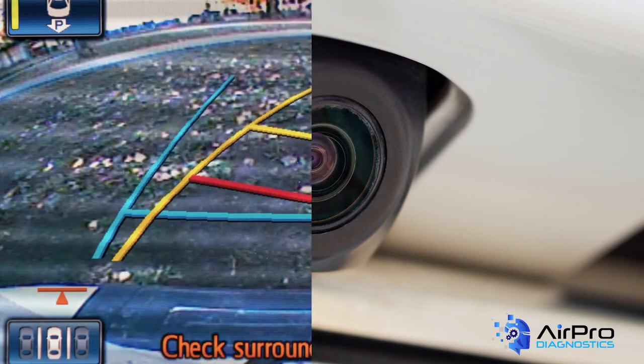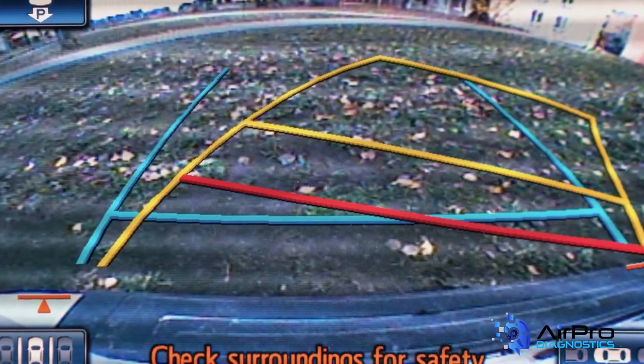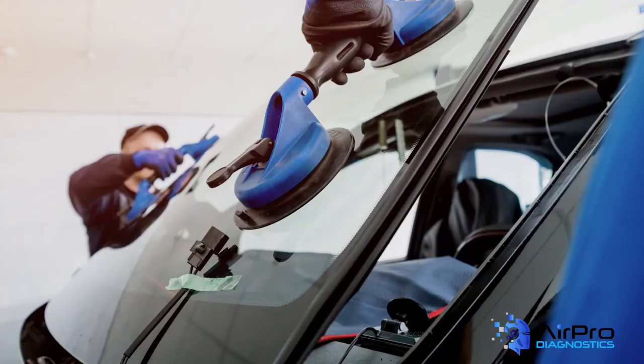So, we identified that headlight problem. What about testing ADAS systems? One thing you can do is put the vehicle in reverse to test the backup camera and backup sensors. Also test components from the repair related to an alignment you did or windshield replacement. A calibration may be required.